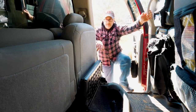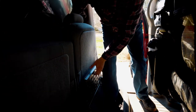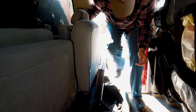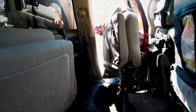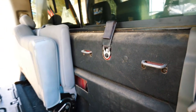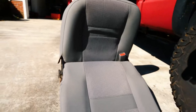Okay, so with the four bolts for the seat removed, I'm going to climb in here. The backrest basically just has little catches on the back, so we're going to lift straight up on the seat and hopefully pull it right on out — just like that. These are the anchors for the seat backrest on the back wall of the truck, and those basically catch right here and come right into the side of that.